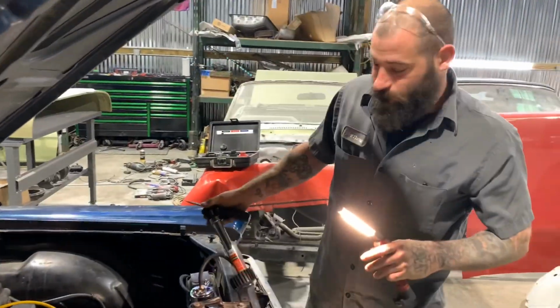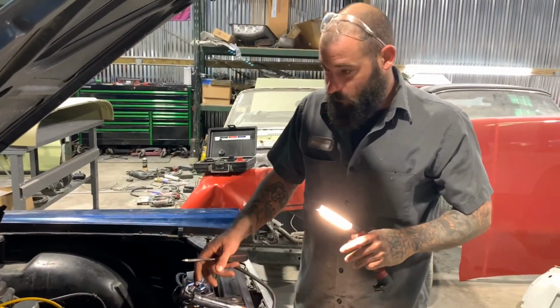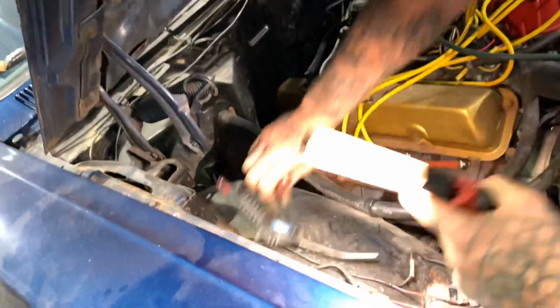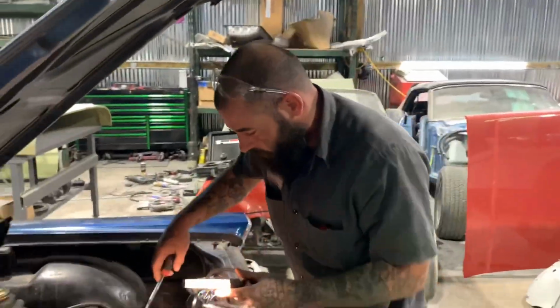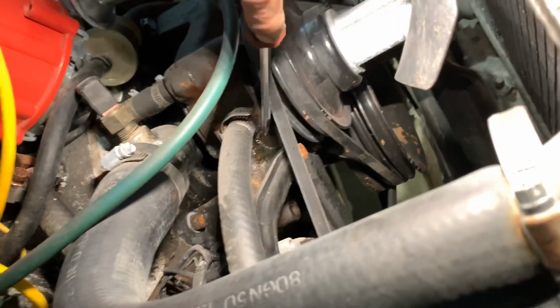All right, y'all. We're still holding tight at 15 pounds, and I'll tighten this up here, and then take your blow gun and blow out all the old coolant that leaked out, and we'll check it. Make sure it's not leaking. I also found another little leak right here. See the fluid? That hose clamp right here was leaking too. All these hose clamps are kind of loose.